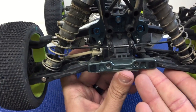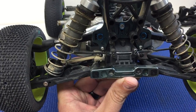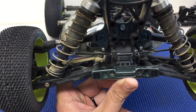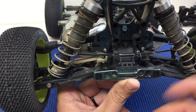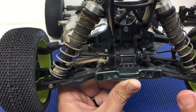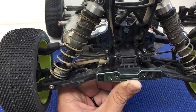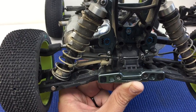If you are running a shorter link and you move that link out — keeping the exact same length but just shifting it out — that is usually better on higher grip tracks and will be a little bit more stable. If you shift that link in, it'll be a little bit more responsive, drive a little bit more square, won't want to round the turn quite as much, and will be better on lower grip conditions.